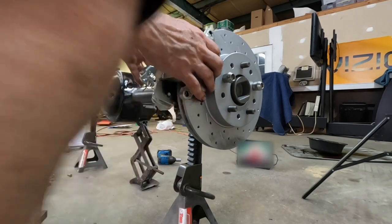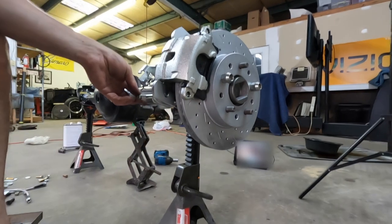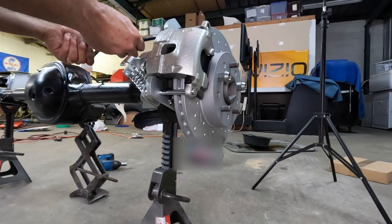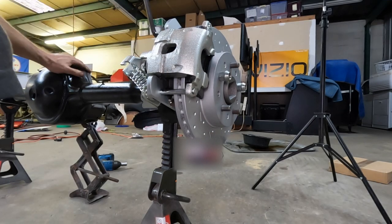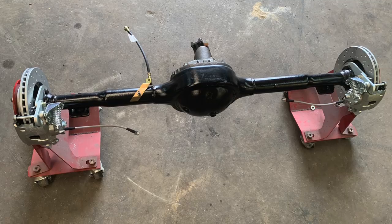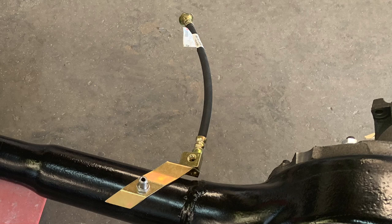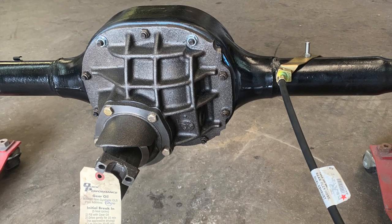The caliper comes pre-packed with the brake pads inside and there's a piece of cardboard that you need to remove. Simply slide the caliper into place and install it with the two bolts. Here's the completed rear end with everything attached. Here is the proper mounting bracket, flexible brake hose, and vent tube for the dual exhaust rear end. If you find value in these videos, please like, subscribe, and share. Thank you.